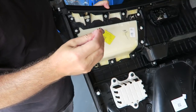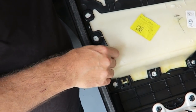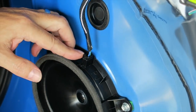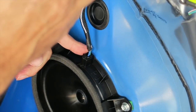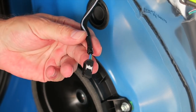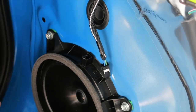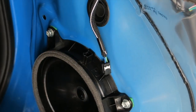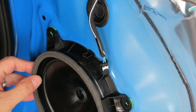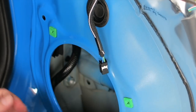That little hook or piece that came off actually came off right here at the top — it just pushes in through here and slides into this slot, so go ahead and put that back in. Time to remove the speaker now. First, remove this little connector right here. On this side towards the front of the door, there's a little push pin type thing — push in and it should just pull right up. These are 10 millimeter bolts; there are three — one here, one here, and one down here. Use a drill to make things quicker. Then just push up a little and pull out.